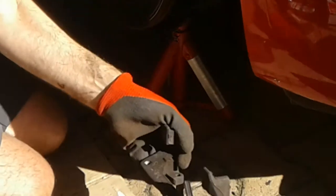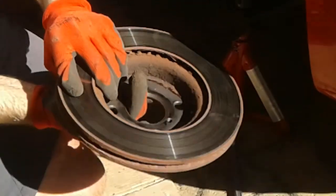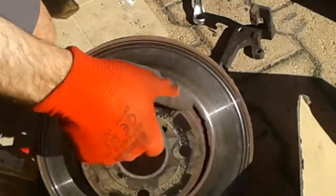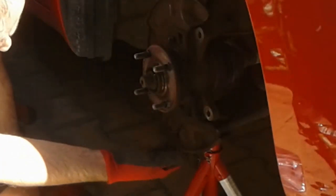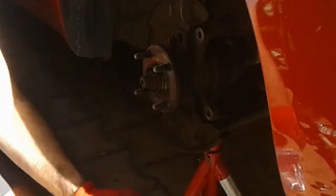So that's the second bolt off — those two bolts there, and that's the caliper. I'll clean the dust off that and the disc just comes off easily then. It's not got too much wear, but obviously that scoring's not ideal, so we'll take that to the recycling. You can see this affects the disc from getting too much spray on it, and it's rusted through here at the bottom. Parts seem to be very rust-prone these days — we seem to have gone back in quality a little bit.